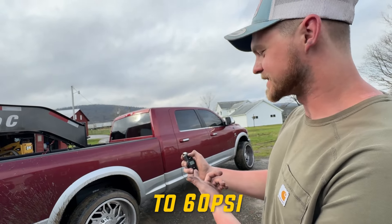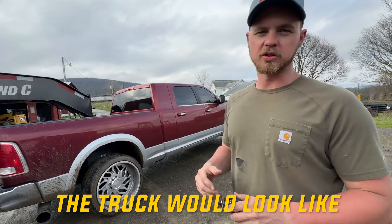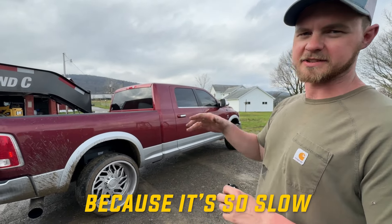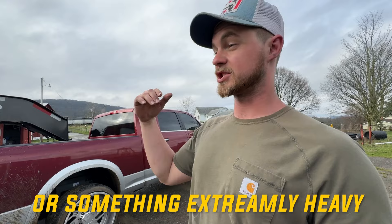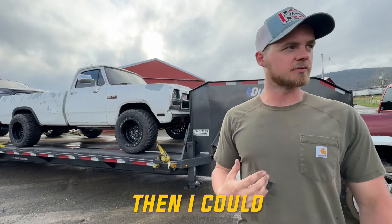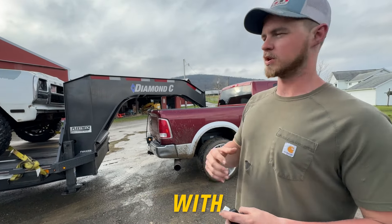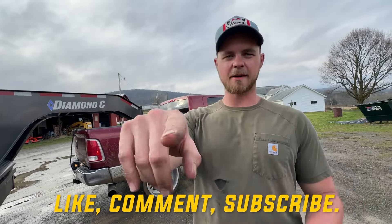We're going to raise up to 60 PSI — it'll raise about an inch or two. Of course if you left it at 5 PSI the whole time you're driving, the truck would look like it was struggling and you're hurting your leaf springs, not helping the bags at all. You can see the truck leveling out a little bit right now. If you had something extremely heavy on there — like a skid loader or a box of rebar — I'd probably recommend going with a higher PSI, 80–90. You don't want to go so high that you're risking blowing lines or bags. Pretty much where we're going to leave off with this video, guys. Like, comment, subscribe — we'll see you in the next one.